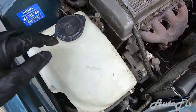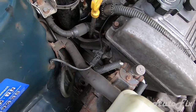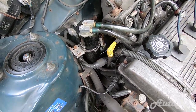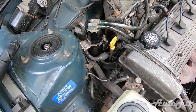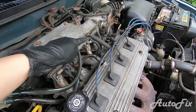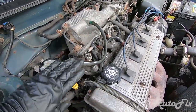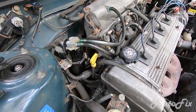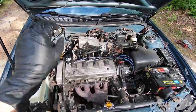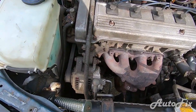As you can see, the alternator is right here, the AC is right down there, and the power steering is right there. This is my oil catch can — I'll be removing it for this video just to get more room. If your Corolla doesn't have it, it'll just have a hose that goes from the PCV valve right to the intake. This is not part of the car whatsoever.